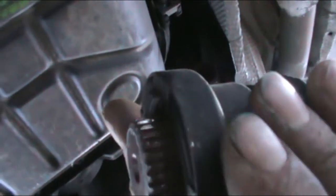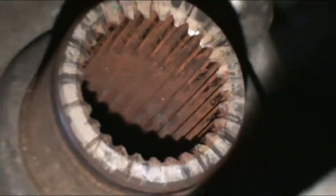Something looks a bit stripped to me — it's just starting, it looks like. So we're going to cut this, weld on the new one. Splines up here — there's the splines. If you see it up there, they go pretty far in there — probably about three inches of splines in there, at least three. I caught mine early, so it's all good now.